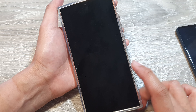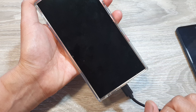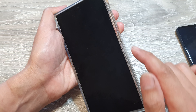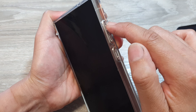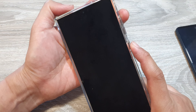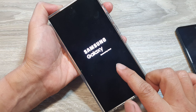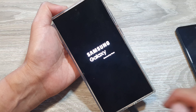Make sure the cable is already plugged into your phone. Once the phone is completely switched off, press the side button plus the volume up key at the same time. You need to do it quick enough — if you're not quick enough the phone will switch back on by itself, as you can see here. The phone switched back on.